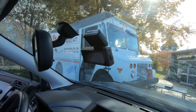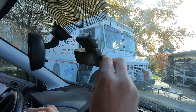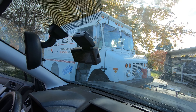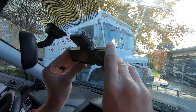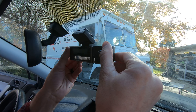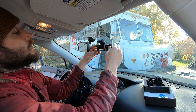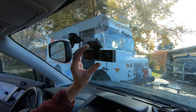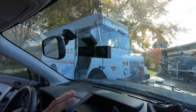Now we're going to install the inside-facing camera. We already discussed that it's just going to be viewing the passenger and people in the back — that's totally okay with the customer. So if you're going to install the inside-facing one, you just take that out and install it like that. And then you can adjust this to your horizon. Once we get that installed and hooked up to a phone, we'll be able to see it and make sure it all works and get the horizon adjusted.